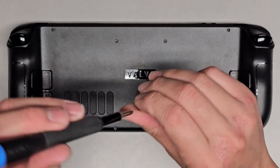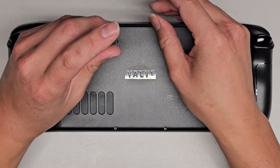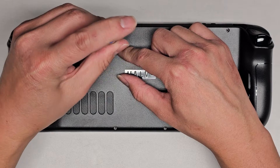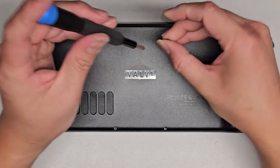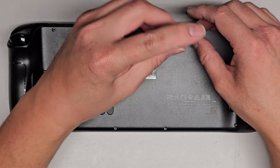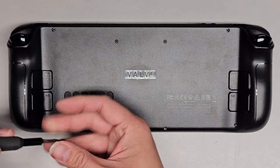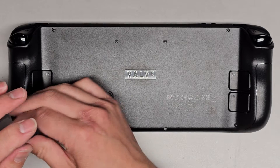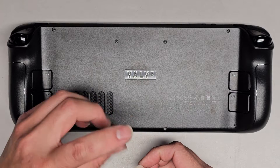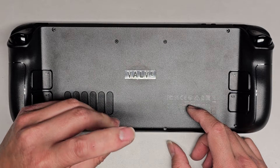If you can't help out that way, it would help a lot if you could watch a few of my other videos and like and comment on those as well, because that's what the algorithm likes to see. Let's go ahead and get the rest of these screws in. It should be very easy to twist these screws. If it's a little bit difficult, you might want to unscrew it — make sure it clicks when you're unscrewing and then go again, because it should be very easy. You can see how easy I'm twisting it with just two fingers. You want to make sure that when you twist these screws in, it's going in really easily — that's how you know it's following the same screw path and not drilling out a new pathway and ruining it so that next time the screw won't be able to hold anymore. Make sure it's very easy to turn — almost zero resistance.